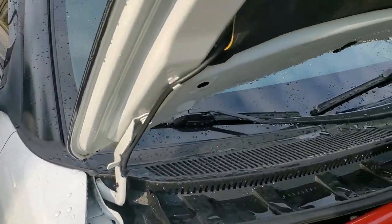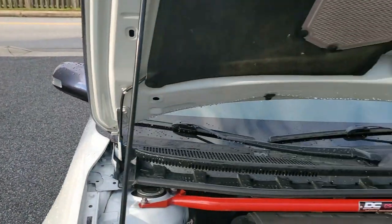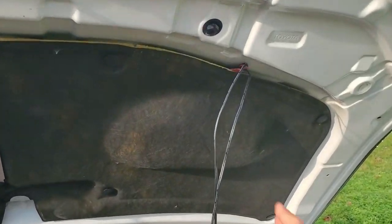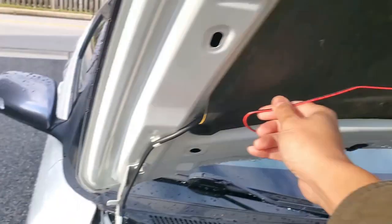I'm planning on having the wire come out here so that I can run it alongside the windshield wiper fluid tubing behind the fender. I've cut the wire so that it's long enough to go from the driver side LED module to the passenger side hinge so that I can install a waterproof connector right here.